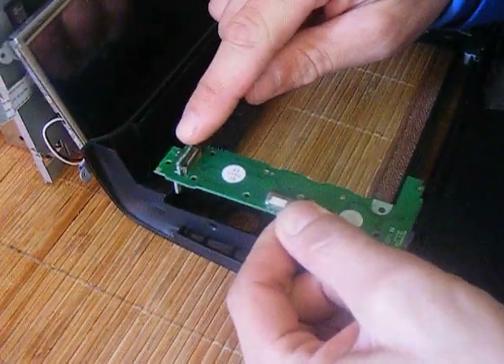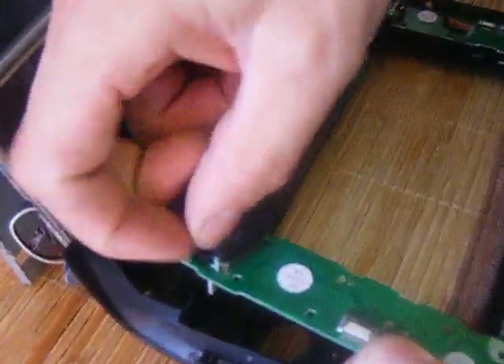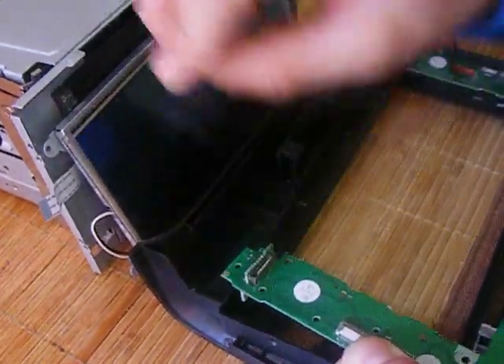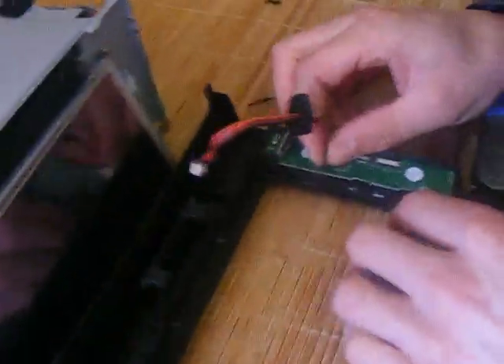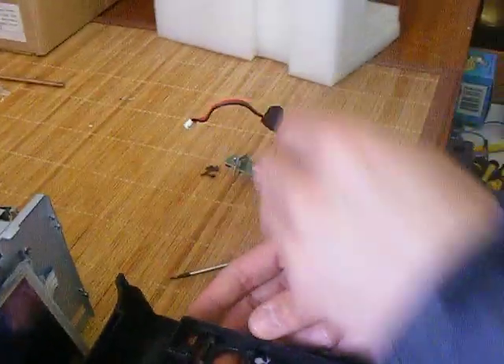Over the back of the SD card reader, these two small bits of black tape will be located like this. They need to stay on there to stop any circuitry problems with the frame. So just pop them off, stick them on the top of the unit, and again, putting everything from the left on the left, everything from the right on the right.